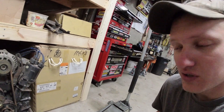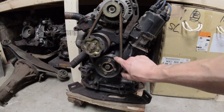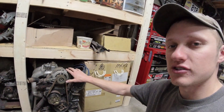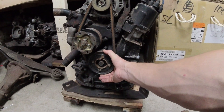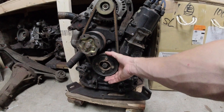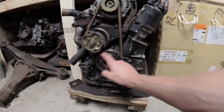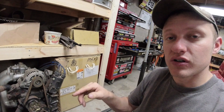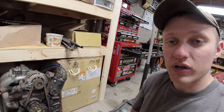That is important for this video. The front pulley — the small pulley right here — should only go on here one way. If you need to figure out how to find top dead center of your engine, I have a video detailing that, but these should only go on here one way. Your timing mark should be right to the engine. This pulley is also 360 millimeters in circumference, which means the 360 degrees of a circle — each millimeter is one degree of the circle, thus one degree of timing.